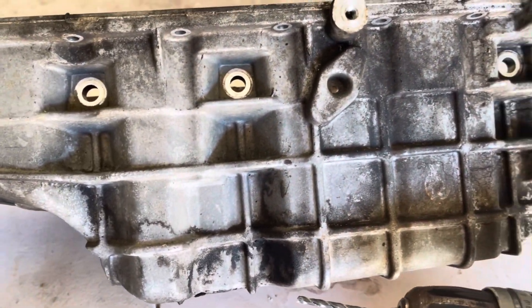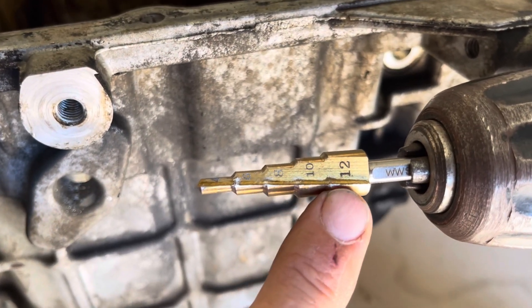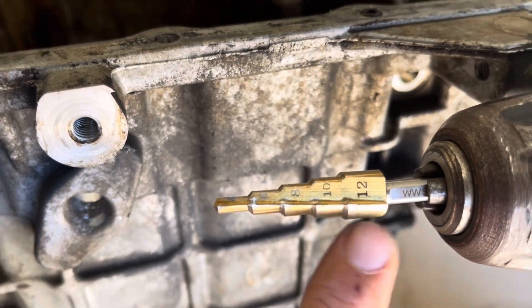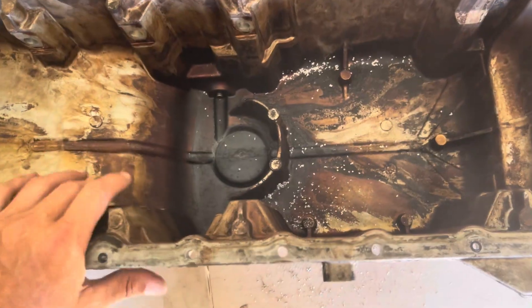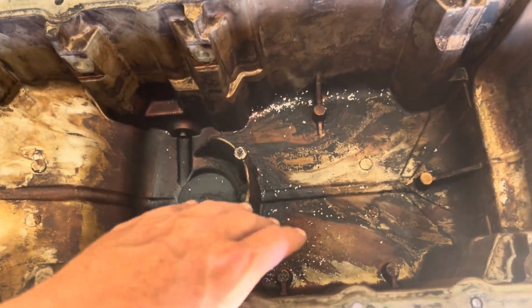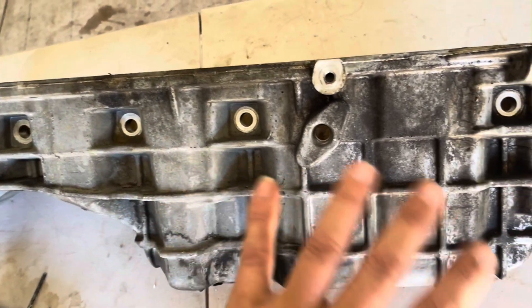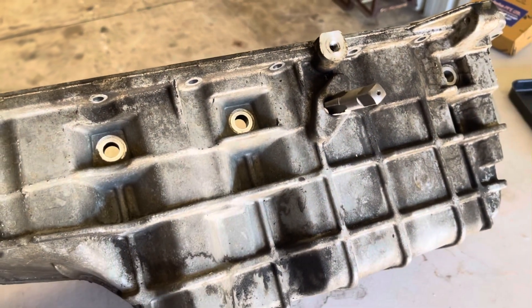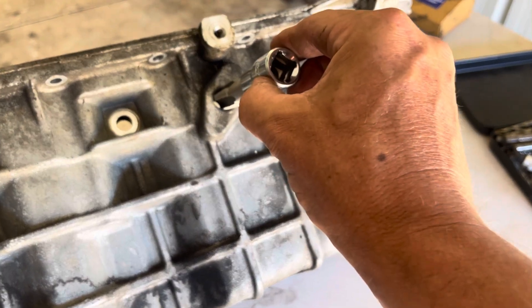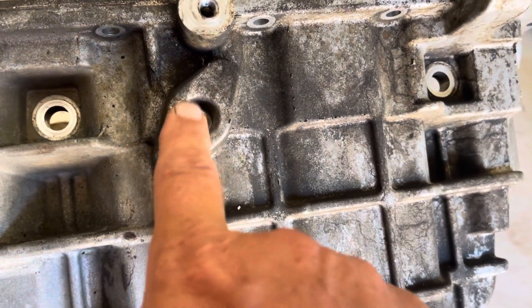Now I'll slowly work the hole out using the smaller step drill bit and see what we're looking at. I've gone through to the last size on this little step drill bit - it's a 12mm bit - so that is pretty much perfect inside that hole. We did get a bit of swarf inside, but that's going to be cleaned out anyway. I'm going to clean all this and paint it before it goes on. I've got this sump here and when I do it I just want to be able to unbolt the one on the car and bolt this one on - that's the whole reason I'm going this route. So I've got the tap out, I'm going to sit it in the hole. A half-inch socket fits on the back of the tap perfectly, so I'll grab a ratchet on that and start cranking.